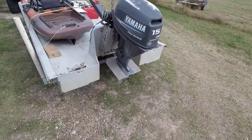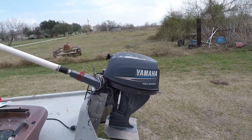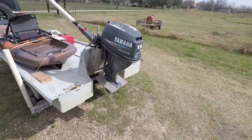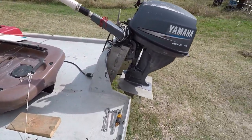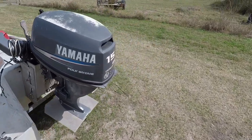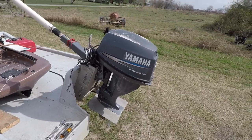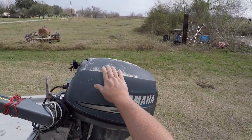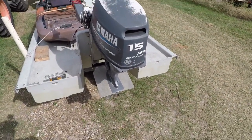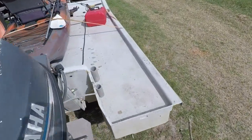Today I'm going to do something a little different on my channel. If you're only interested in fishing videos you may not find this very interesting, but if you stumbled across it because you wanted to learn how to change a water pump in your outboard motor, this may help. Today we're going to change just the impeller, unless the cup and the plates look like they're worn out. The motor sat out in the sun for about three or four years with no running, and when I put it back into operation I noticed it wasn't pumping a very good strong stream.